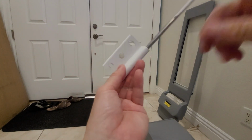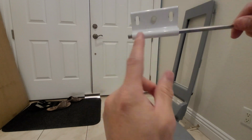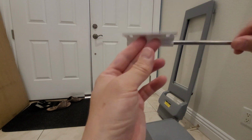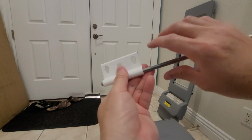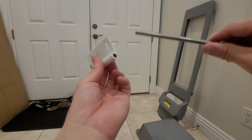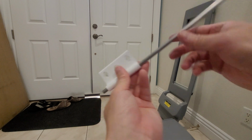So what's happening over time is, because these hinges sit on the outside, when the rain goes down, it corrodes over time, and basically your hinges can seize between these dissimilar metals. So that's very important. Obviously you could take the entire door apart and put some kind of, I don't know, probably grease would work better than what I'm doing.